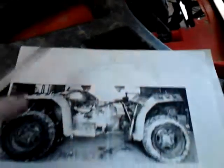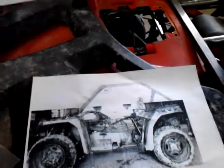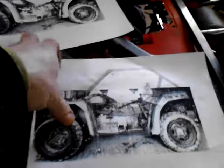I've been going off some photos that I took and made some concept drawings of how I wanted the cage to look, and I finally came down to this one right here. With this new bender I came up with my angles — that was 45 degrees there, 60 degrees here — and all my lengths. This is the back and the front.